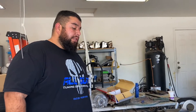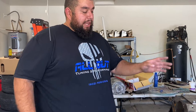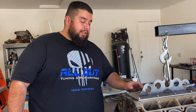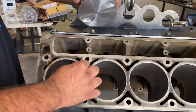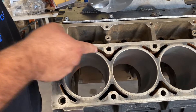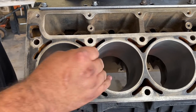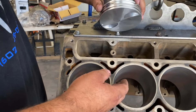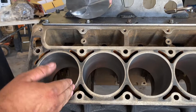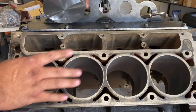I'm hoping this setup is going to put out a little over 400 — around 420 horsepower — once all said and done. It will be backed by the 4L60E, which does take up about 15 horsepower. As for the bore, there's still plenty of meat left in between. A few 6.0s have been punched out to a 6.2. This is not recommended if you're going to boost, but for a naturally aspirated setup or maybe some nitrous, it's fine — it's still a strong iron sleeve.